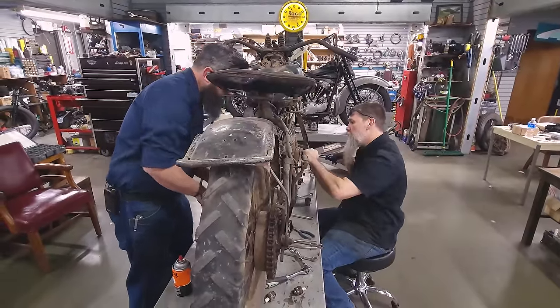Here we are — gray band around the center of the valve. The unlapped valve to the lapped valve: real shiny here as a machine surface, and then your lap surface, which is pretty good. I think we're pretty solid. We've got the blue — a dye that transfers really well. We'll spread it on the seat and then slap this valve closed. What you're looking for is 360 degrees all the way around the seat — that tells us full seat. It's everywhere. All right, one down. Let me lap in number two.